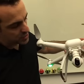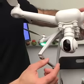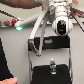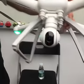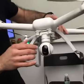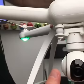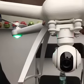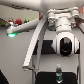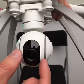It's a Sony sensor, 12.4 megapixel for the 4K camera. And it is 14 or 16 for the 1080p camera. In any case, it's a little bit higher resolution for the 1080p camera. It's got, you can see, a semi-spherical lens here. This gives you about 104 degrees of wide angle. 104 is wide enough to give you a good image without any distortion, since you don't really want a fisheye type experience with this lens.